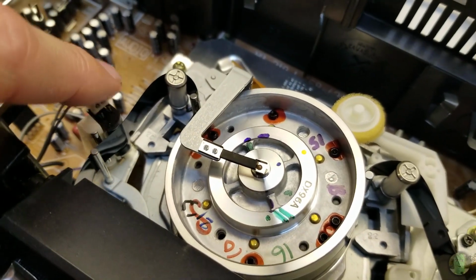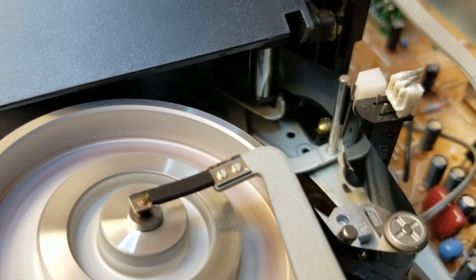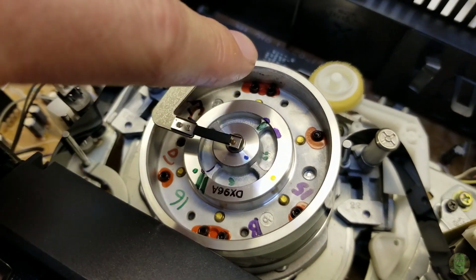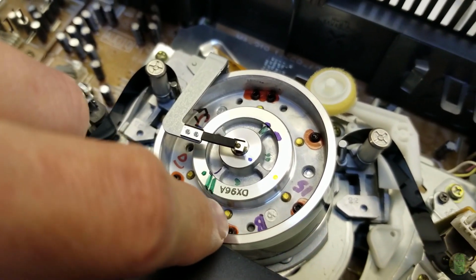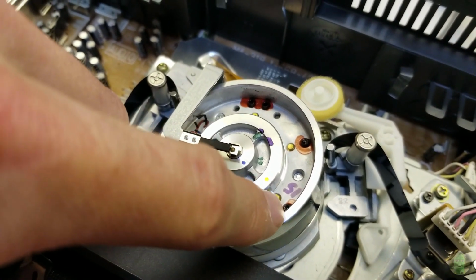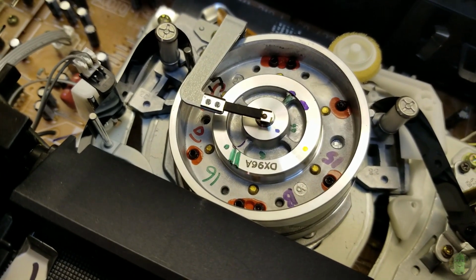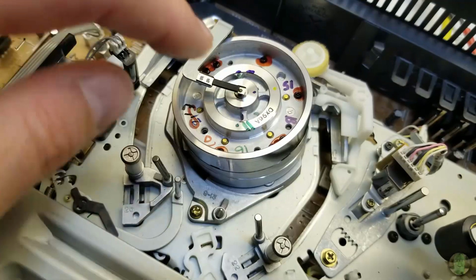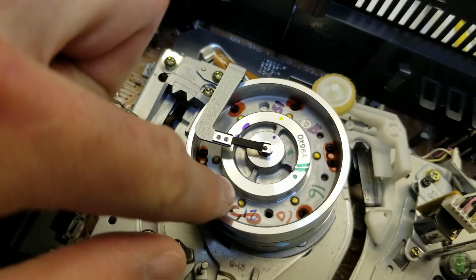So in addition to your standard erase head, there's another head added to the video drum right here. So you've got video heads, your 4 video heads, dual azimuth, your hi-fi audio heads, and then there's this additional head here. It's used for erasing the tape right before the other heads. So the head spins in this direction. Let me line that up again.